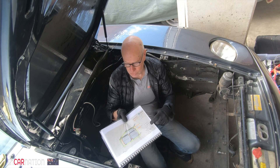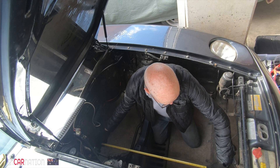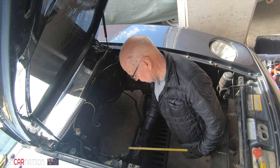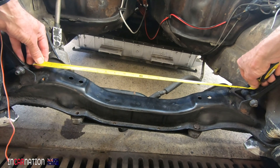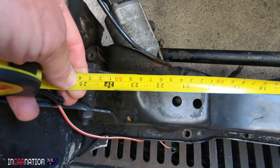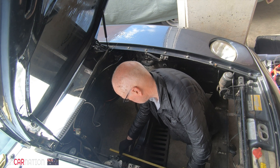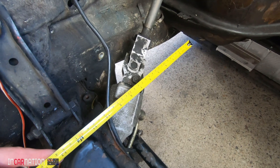550 tall, 920 long, 640 wide - those are the key numbers. 920 length is fine, we've easily got a thousand, so no problem there. These are the engine mount points - obviously a very good place to mount it. 640 wide is tight; 630 would be better. At 630 it does clear the steering box, which is just here, and we do clear it.